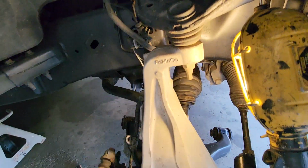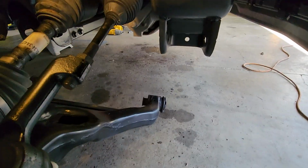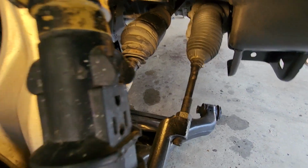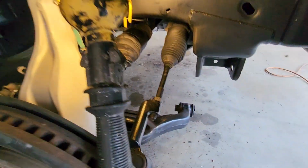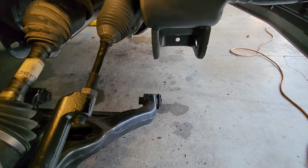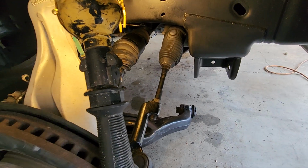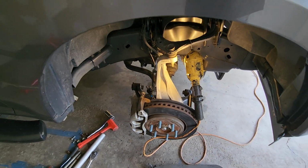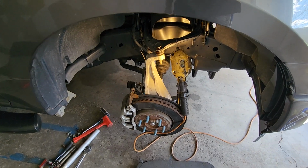So you don't have to disconnect the ball joints or anything. You just, like I said, take the A-arm bolts out, pop it down, pry the strut assembly from the A-arm, wiggle it all out, and do the reverse, putting it back in, and then you jack the A-arm back up, and it goes in pretty easy. Easier than you would think. People make it out harder than it is, and it actually ain't too bad of a job to do a level kit or remove the strut assembly.